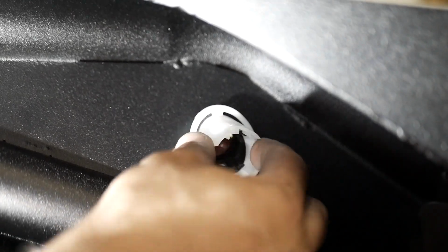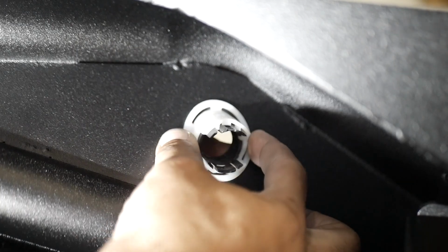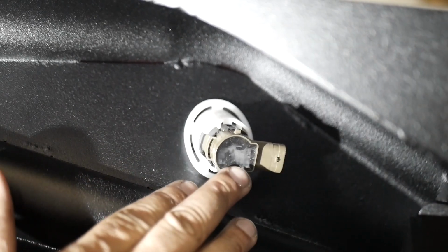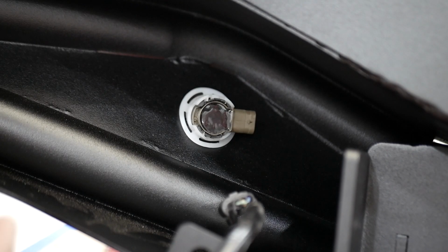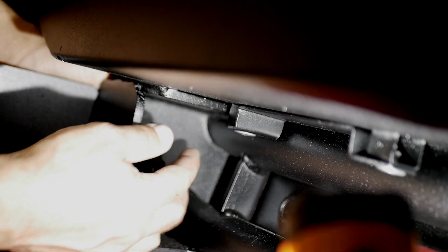Transfer the inner OEM isolator into the RTR bumper. The bumper holes have very close tolerances to maintain positioning. Reinstall the inner and outer sensors into the isolators with the connectors facing towards the center of the bumper. Note that the 2 wire harness branch for the license plate light is to be on the driver's side and will be connected last. Then, starting on the passenger side of the bumper, connect the harness to the first sensor and feed the other end through the hole in the bumper mount.